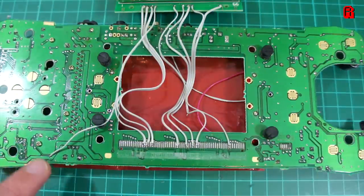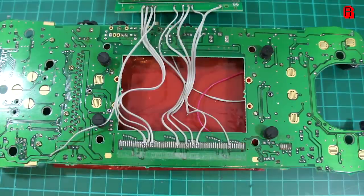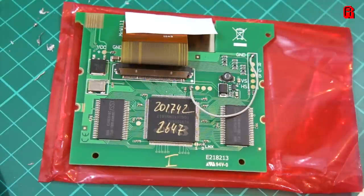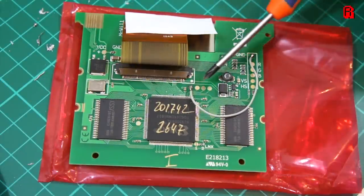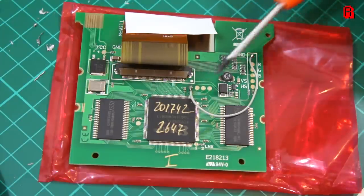And with the final cables in place, checked and double checked, let's try a power on test and see what happens. One last thing — I've grounded pin one on the back of the screen, which should be done if you're not using the VGA output, as it disables the options for that output on the screen. More on that shortly.